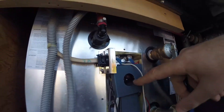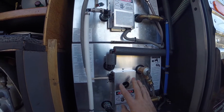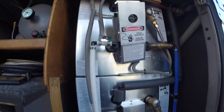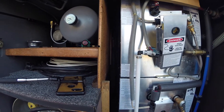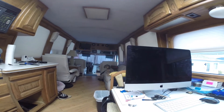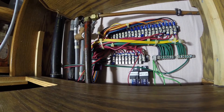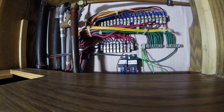This top unit here is for the Webasto. And then I've done the same exact thing down here, with the same stuck-on thermostat, wired exactly the same, except that its wires run up into the kitchen. We are at the kitchen table, kitchen sink here. Here is what I have installed inside the kitchen cabinet. I've added the two relays there - one key-on, one Webasto. They both control the same solenoid from the same signal. We've got 12 volts coming from the freezer circuit, patched underneath the coach in the main junction box for DC power.